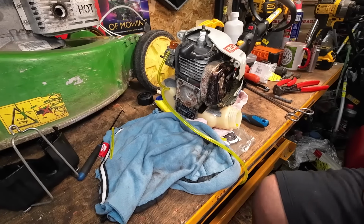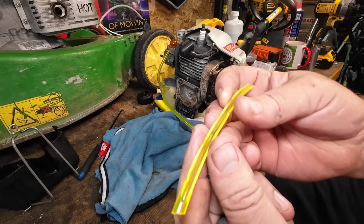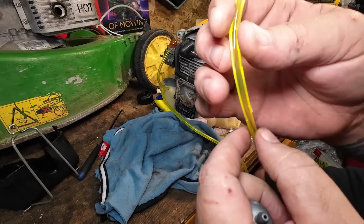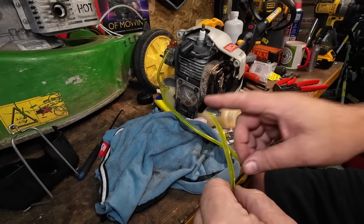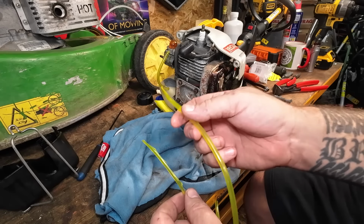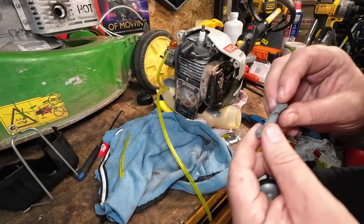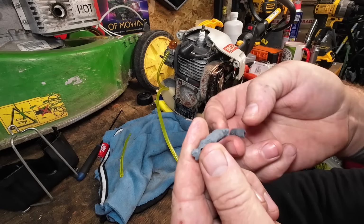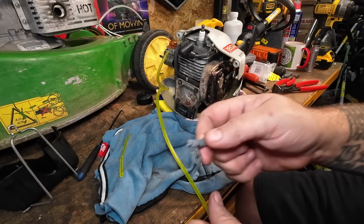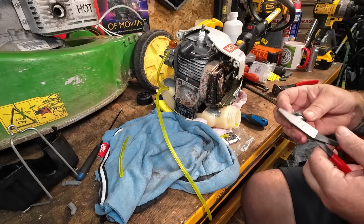Right. I'm not going to lie, that was an absolute pig. What I had to do, I had to cut about 3-4 inches of pipe so that it was tapered. Because that is a really, really tight fit. It hasn't collapsed the hose in the hole, but it is a really, really tight fit. But it's got to be that tight, you know. There's some of the JB weld, or Terrell putty, that was pushed through that had fallen in the tank. So I flushed the tank out, but now I can fit this fuel filter